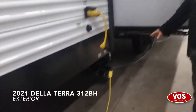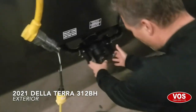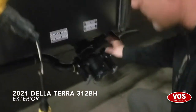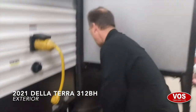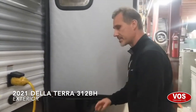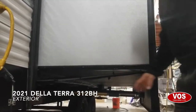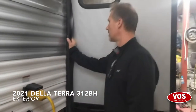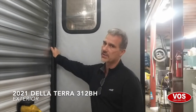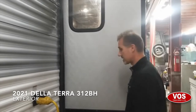There's a black tank flush to help you clean the black tank, and the dump outlets for your gray tanks and black tank. You'll notice color-coded handles — two gray handles and one black — so this trailer is equipped with two gray tanks. All slideouts on this product line use a rack and pinion system, which is the best the industry has to offer. There are also double wiper seals and a track-mounted bulb seal that will never come off.